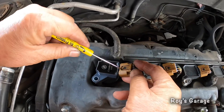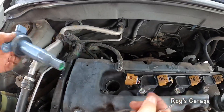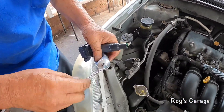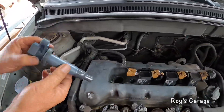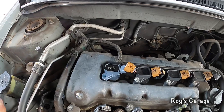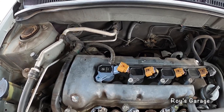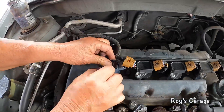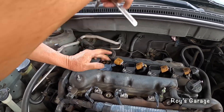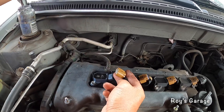Removing the electrical connector. I'm going to be putting some dielectric grease right in my coil. Then I'm going to be putting it back in and bolting it down, but first I'm going to put some anti-seize on top of my bolt.